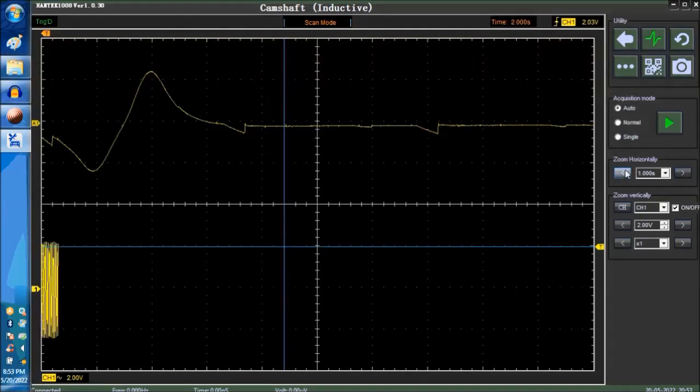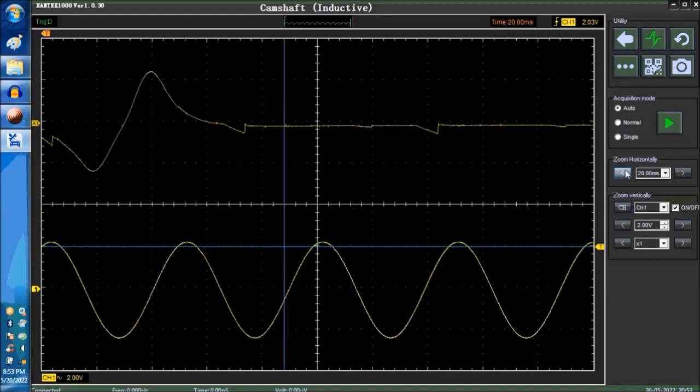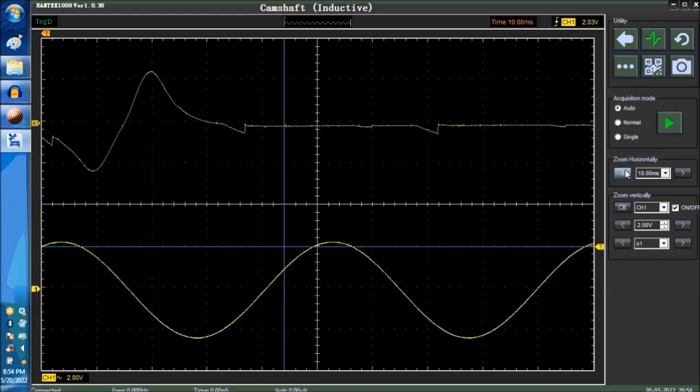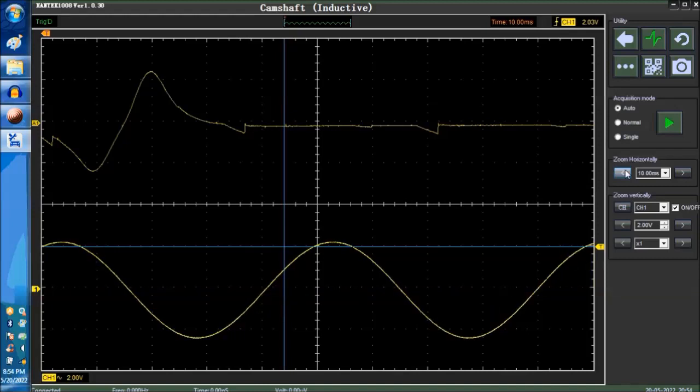Now, if your waveform is only showing one cycle, say we're looking at one cycle only, okay? We're creating glitches right now, and you can barely see them. We're doing it one after the other. If they're long enough, you could capture them, but not like right now. We're doing one glitch every second, and you can't see them. Sometimes you can, sometimes you cannot, especially if they're too fast.